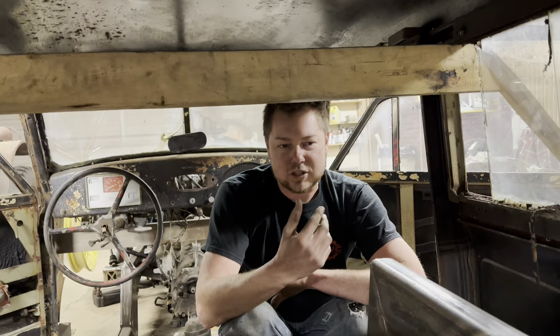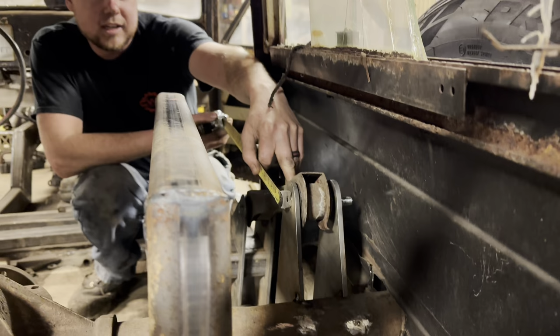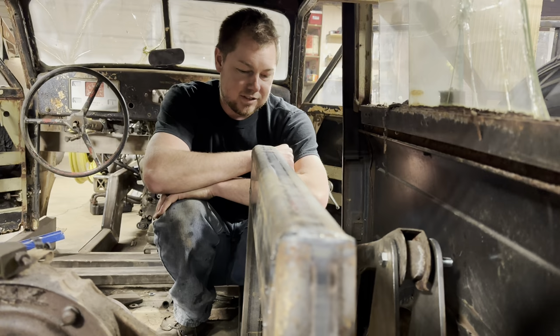So when this car airs up, this is all the way down. It'll air up 4 inches. And I think I got it figured out at 4 inches. These bars here will end up being straight like they're supposed to. So we'll be like this. The car airs up and it'll run them straight like this tape measure. That is the game plan. So I think everything is where it needs to be. So I guess start welding it together and going from there.